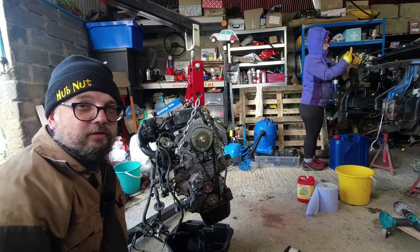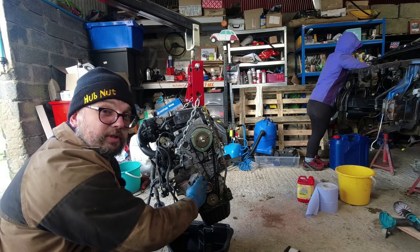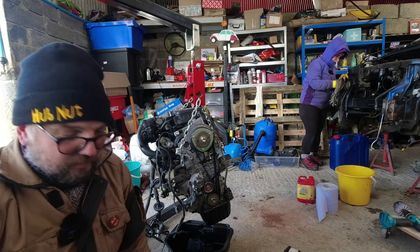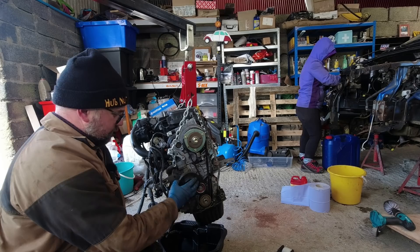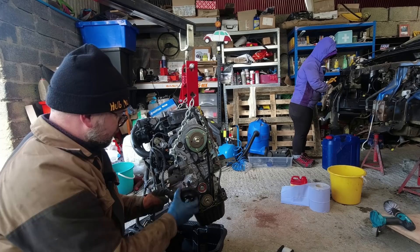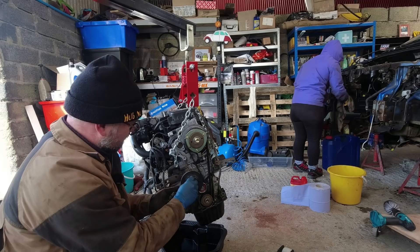The water pump doesn't want to turn at all with the pulley on — better to discover now than when the engine's back in. Yesterday you said 'oh we just got the water pump to do, that's easy!' The pump turns fine on its own, but with the pulley on it's obviously hitting the casting somewhere. I'm going to look at the pulley on the old engine to compare. The old engine's pulley looks like it'll work a treat — these two pulleys are very different inside, with this one having extra gubbins that won't work for us.